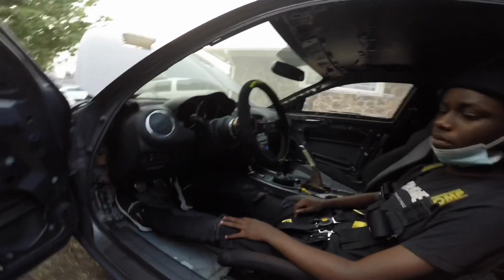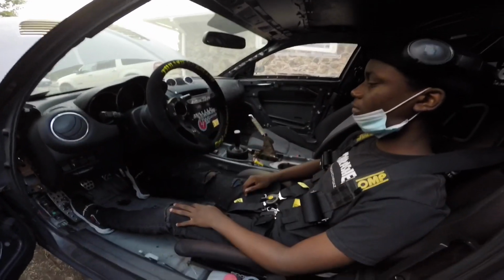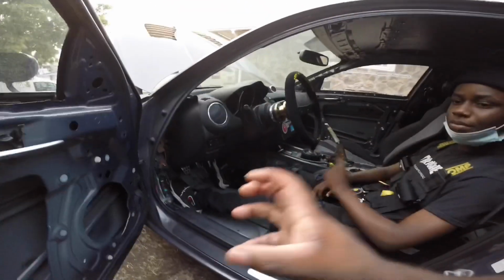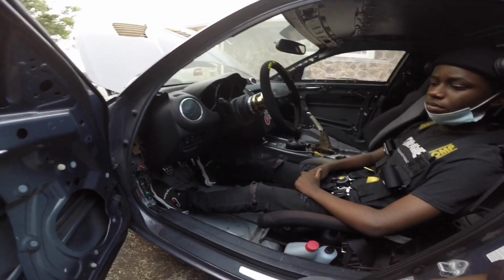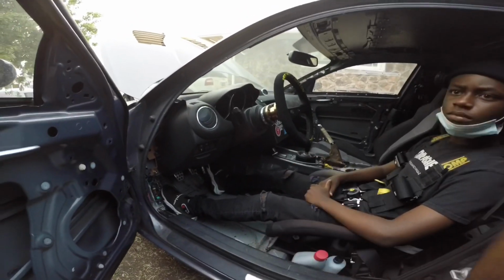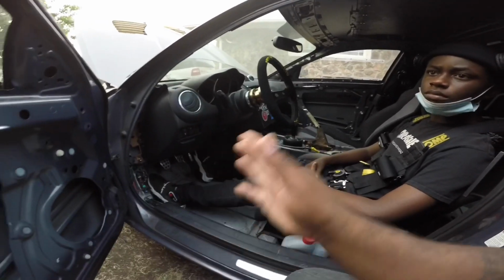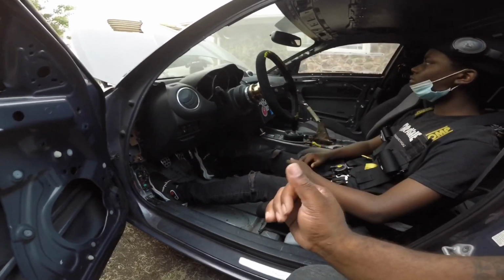Brake bias knob is for sure going to be purchased, and I'll just put that somewhere on that carbon fiber panel that you see right there. And that's because, like I said, the big old super strong calipers in the front, they make this car stop excessively fast. But I feel like when I was jamming through the back roads, and it could just be the rate that I was going with changing directions, the rear seemed like it was under braked.